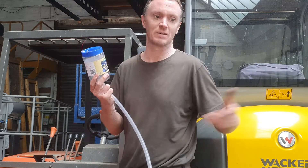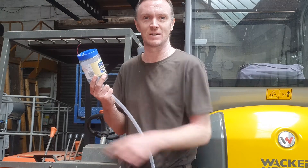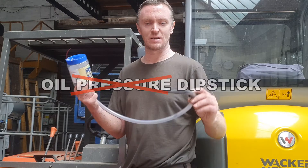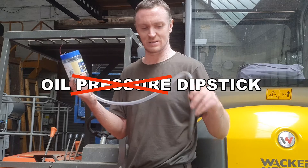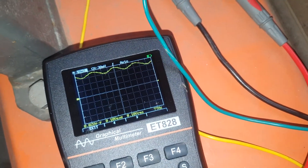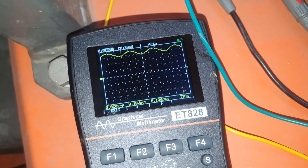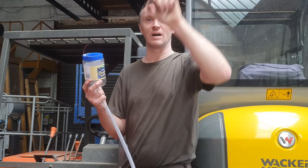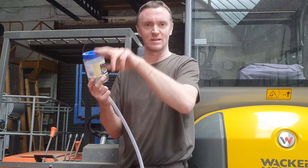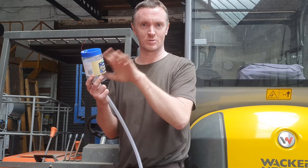You can keep this in the van all the time for on-the-spot diagnosis. You can equally put this onto the oil pressure dipstick — I just held it on with my hand. It doesn't give a huge signal but it does give a signal. If for example the piston rings were leaking a little bit, you might see a difference between the signals — a normal reading, then a rise in pressure on the cylinder with the fault, then a normal one again. So you'd see: normal, high, normal, normal, high, normal — and that could indicate piston ring wear.